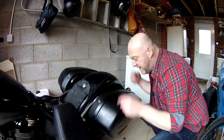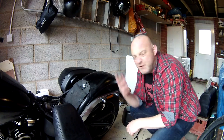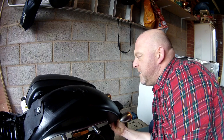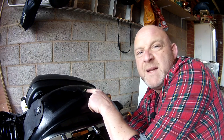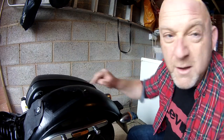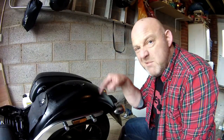Okay, first thing you need to do is remove the side bag here. That allows you to get your arm underneath the fender and just poke it through. Get your bolt, feed it through underneath here, locate it through, rotate it until the notch is pointing through as well, then just get this little sleeve here, pop it underneath there like that and that will stop the whole thing falling through. Just slide that through underneath and that stops it going through. Easy peasy.